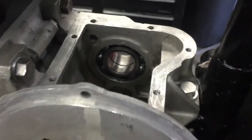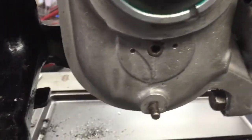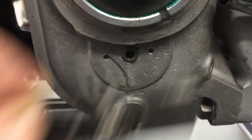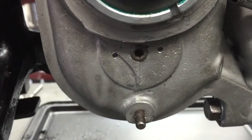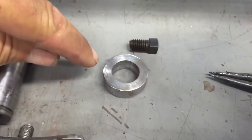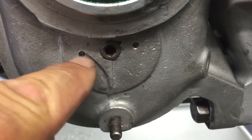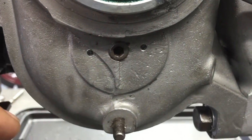So let's go around to the right-hand side of the bike. What we do is actually make up this jig — a little drill jig — and drill two one-eighth inch holes. Where those one-eighth holes are is actually coming in to there and there. We actually get a punch and punch on the back side, and we're going to check to make sure that the bushing is good and tight.